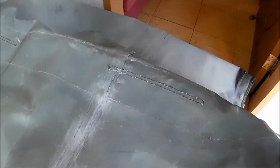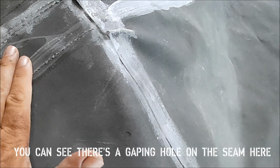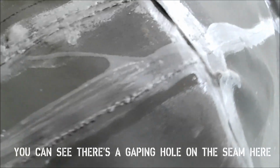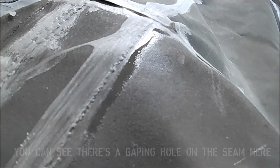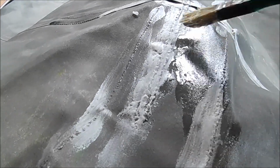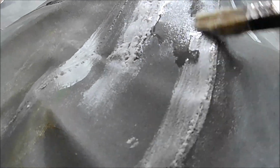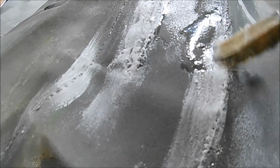Our repair jobs, which did finally get done a bit better. Okay, more wax. We've got our wax already melting. You can see the sheen on it. Now that the heat pulls it into the canvas. The brush helps the wax melt into the fabric, and it will come all the way through underneath because the wax will be attracted by the heat.